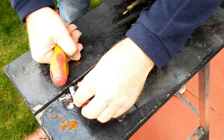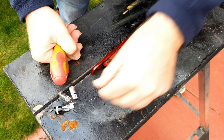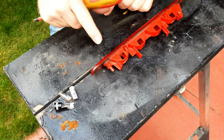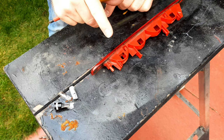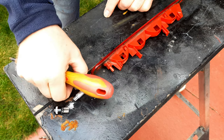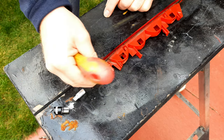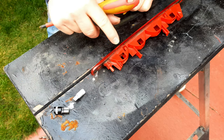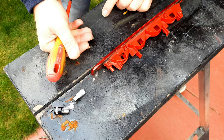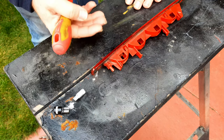Over the last couple of years I've tried a number of different bulb types, and it took several goes before I understood about the parabolic reflector. I also found it's important to use red bulbs — if you use white bulbs, they're so much brighter than a standard filament bulb that they wash out the red colour from the lens and will actually fail the MOT in the UK for being too white.